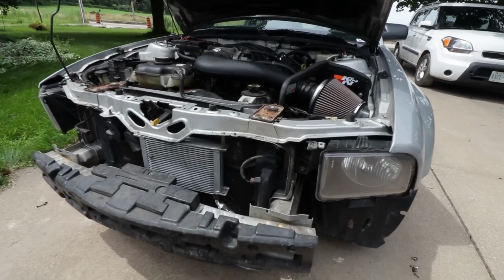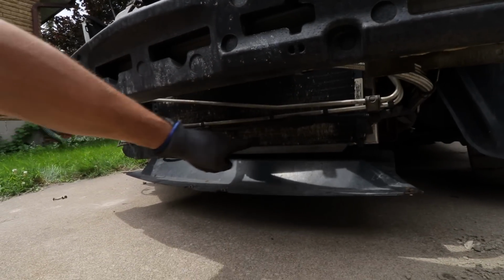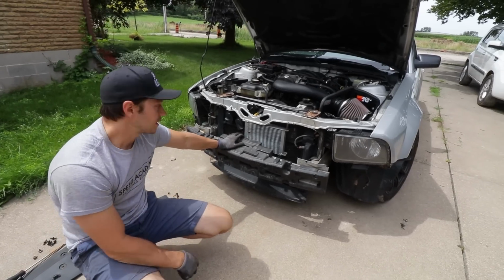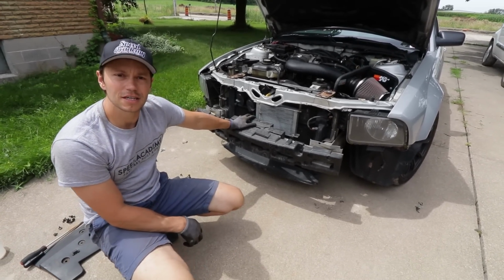The condenser is a mess. Dirty. Look at down here. This is all flattened to hell here. Yeah, yeah. So really, we're just lacking a ton of... There's no good airflow to the rad, is there? Fresh air heading there, yeah. So we're going to remove the front grill. I think that's a good start for us.